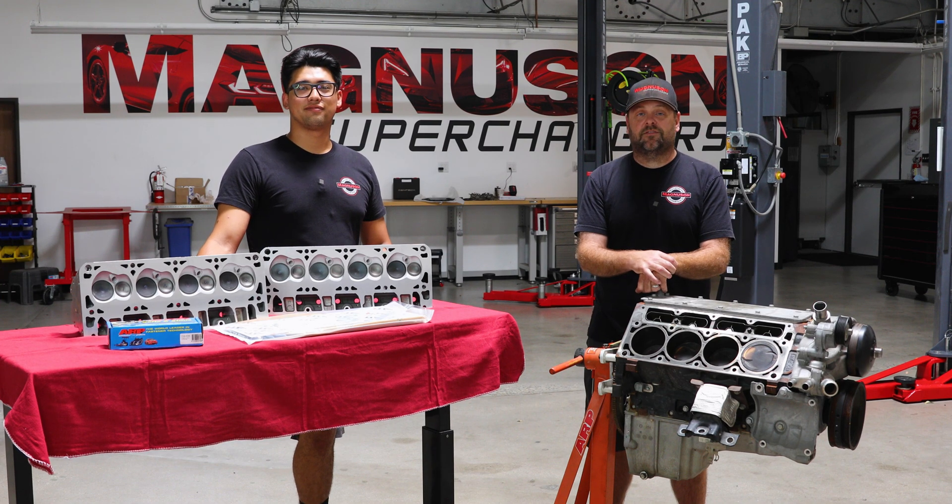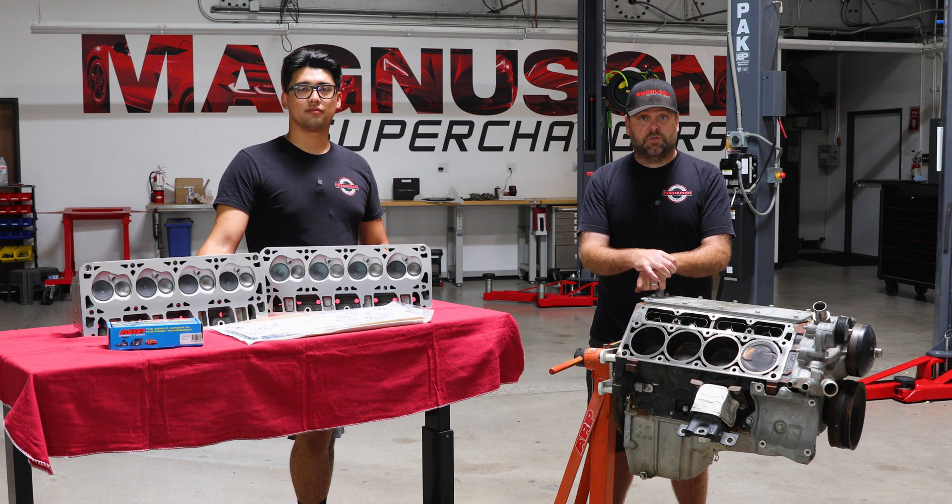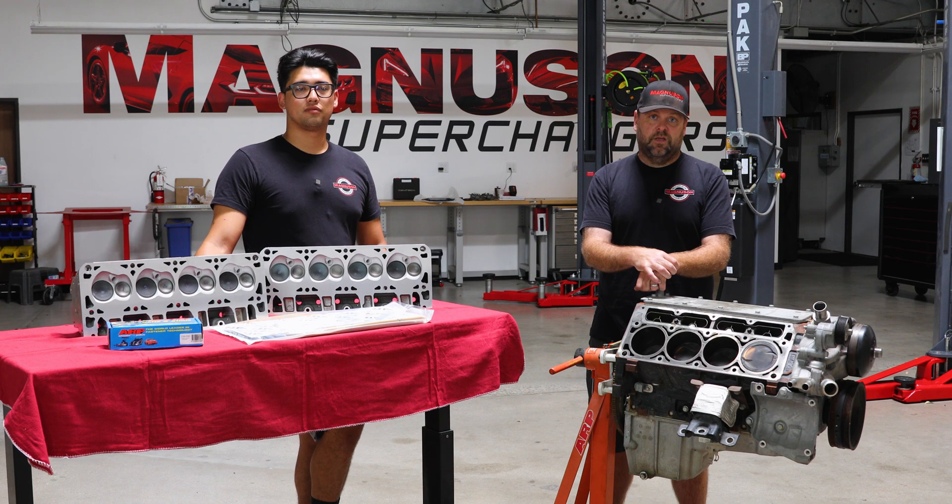You may have noticed in that first step of the leak down test, cylinder number one was showing 70% leak down, so we knew that was a problem. We didn't really talk about it at that moment because we wanted to get through some of the other steps. But after the camera was off, we went through the other eight cylinders and found that number four was also having a leak down issue at the valve. So project creep led to the heads coming off.